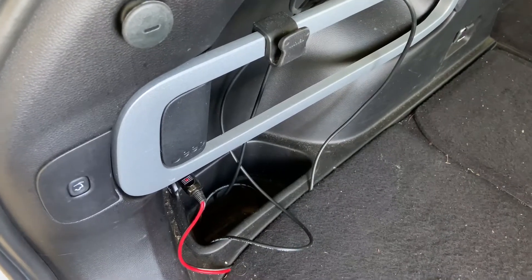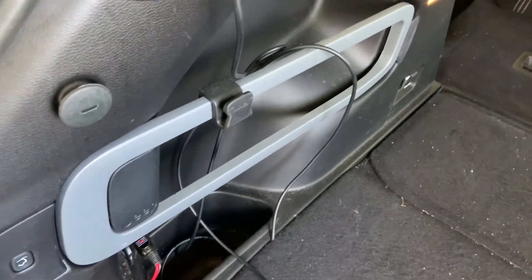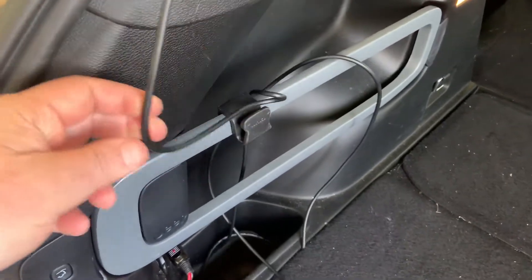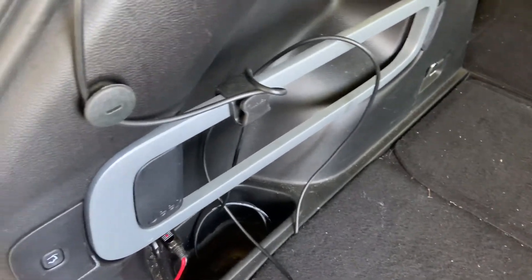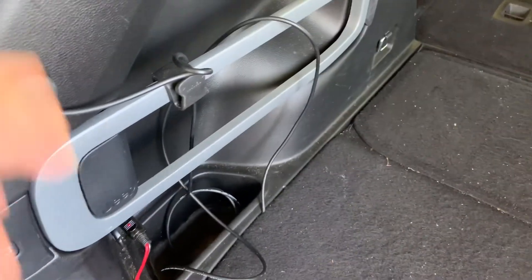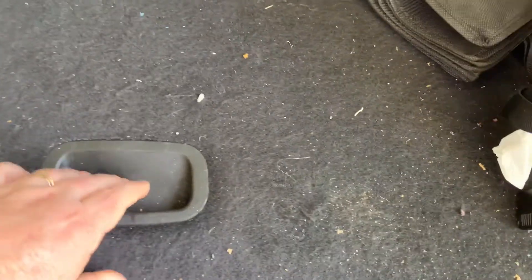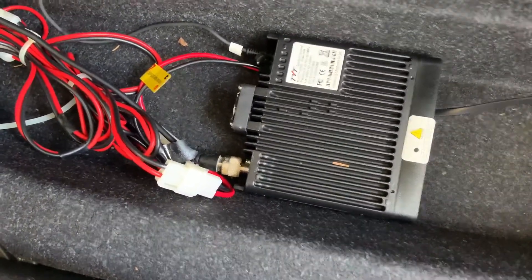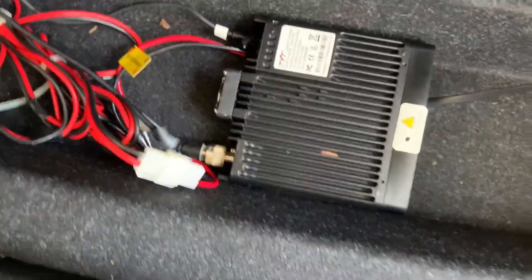To hopefully keep the rain from coming in again, I took the coax cable and looped it around a little hook here, and it just seems to work better — I've had zero water in here since. The body of the radio I'm keeping under the spare tire cover. It's totally dry and totally working.